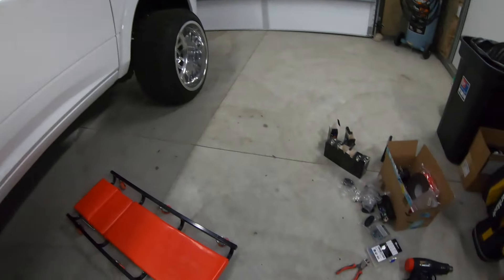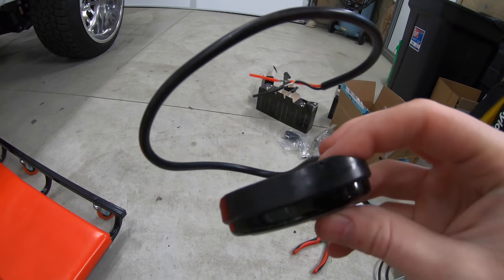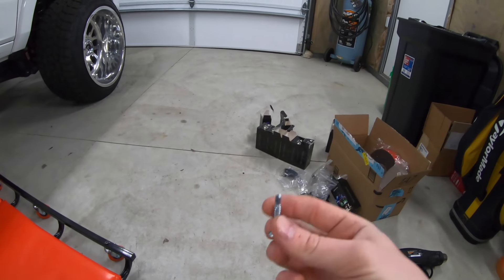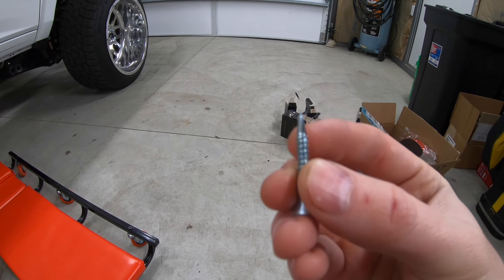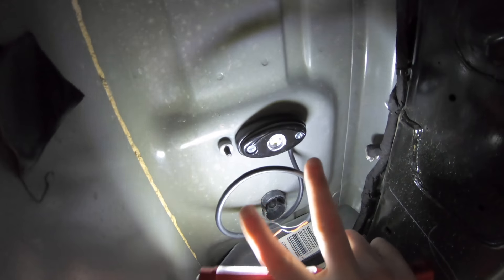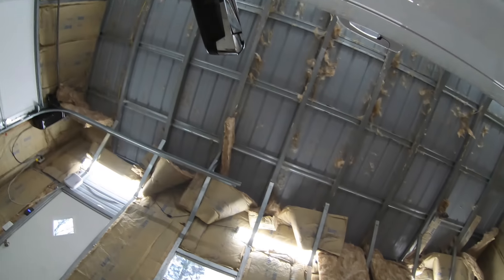Just got the two mounted underneath the doors. For these rubber plates we need a little more room to run the screws — unlike the wheel liners where you didn't need the bottom plates. Got some self-tappers going into the bottom of the cab. Make sure they're not very long — you only want to go one or two screws in just to get it to hold. Here's the spacing I liked: two self-tappers there, another one there. This light gets some light off the rear wheel liners, and the front light still gets some from the front wheel wells.